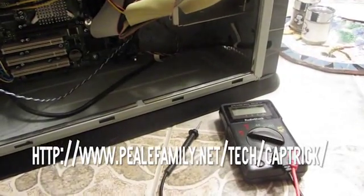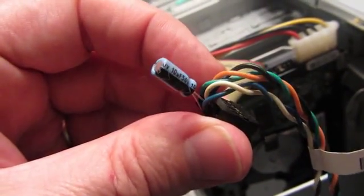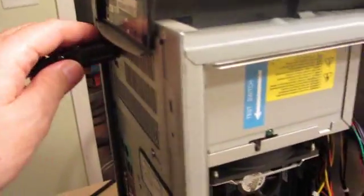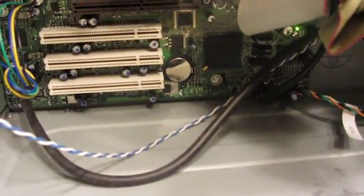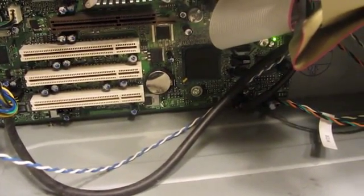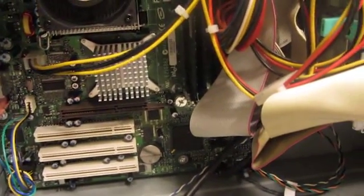If the BIOS method isn't available on your computer, there's a link showing how to use a capacitor to do the same thing. This 10 microfarad capacitor is plugged into the connector for the power button — you can see the connector with the capacitor plugged into the board. We plug the power in and you can see an LED that shows it being powered on. The LED was held on for that long because that's how long the button was fictitiously pushed by the capacitor. We just heard the machine boot, and we now have a machine that will boot when power comes on.